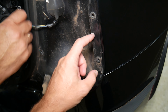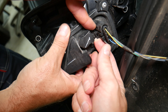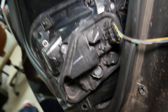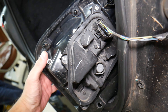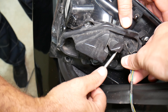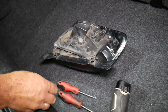There's a hose right here, so you need to pull it out. Now we're going to disconnect the wire here. I need to get a screwdriver to disconnect this connector in order to get to the bulbs, so we can twist the brake light assembly out. Try not to pull on the wires — pull on the connector only. Perfect.